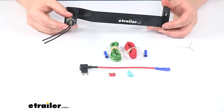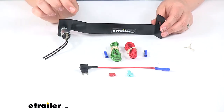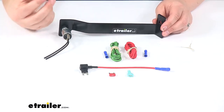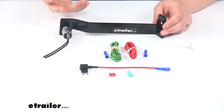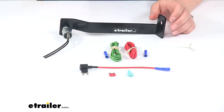This is going to allow you to use a brake controller for your Sprinter. There's no real good way to get a brake signal under the dash that you'd typically need for that brake controller to get wired up properly, so this is a solution so you can use that brake controller and have those braking functions going out to a trailer to slow it down.